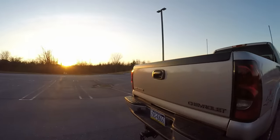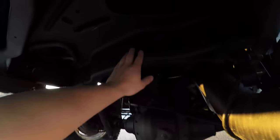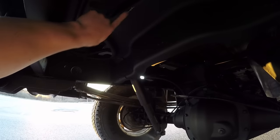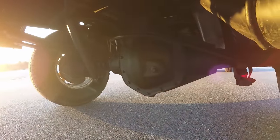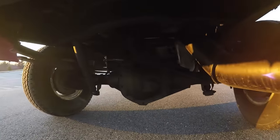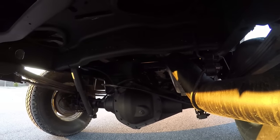I've been keeping very busy with this truck, especially taking advantage of the great weather — I've started the undercoating process. This is a 2005 northern truck and it's pretty clean underneath. I sanded everything down, pretty much to bare metal — there wasn't a ton of rust to begin with. I've got about up to the gas tank done so far. I put about six layers of paint on there and then a rubberized undercoating on top of that.